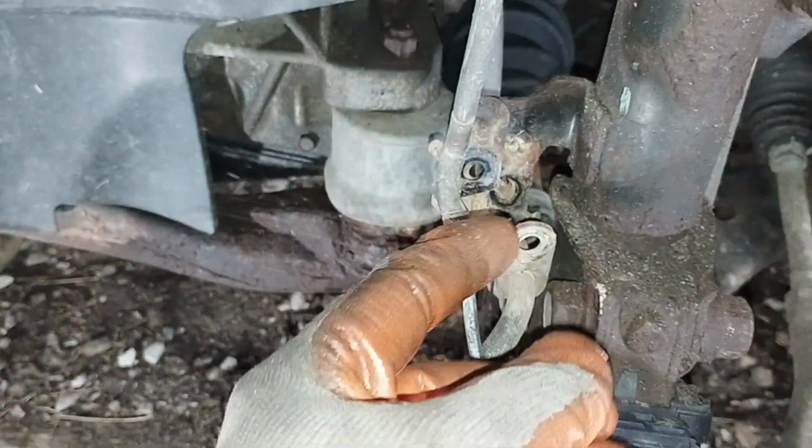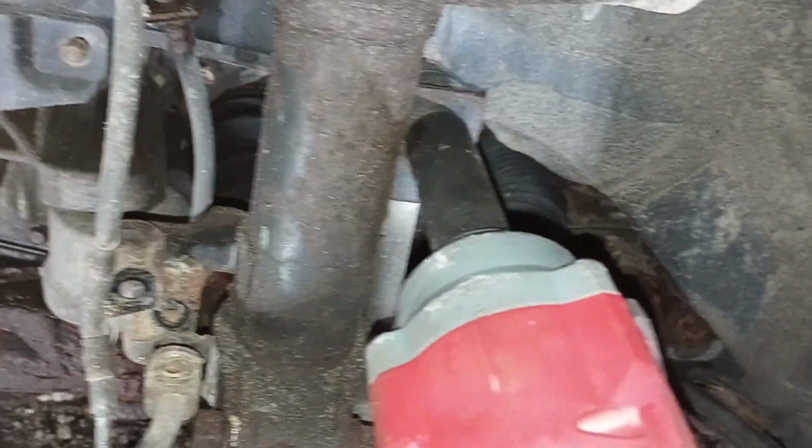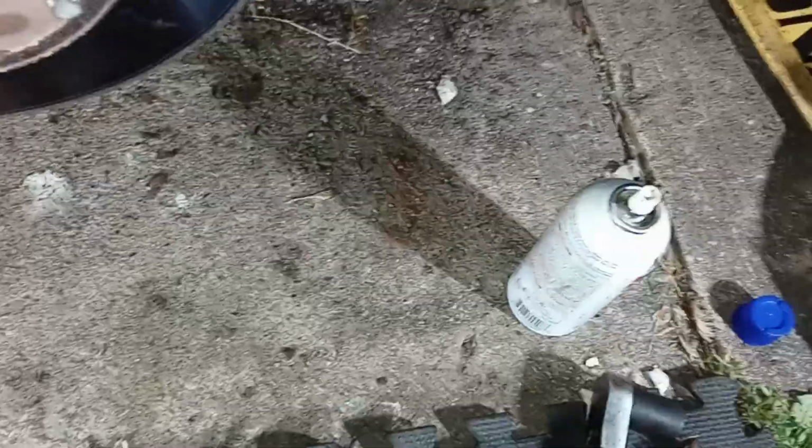Take that 14 millimeter out there. I like to go back and forth a little bit to get that broke loose. I'm probably going to hit with some more PB there. Alright, yeah, you're going to need a small little pick. I'll put a link in the description. Clean out this hole here, or a pair of vice grips on the backside.